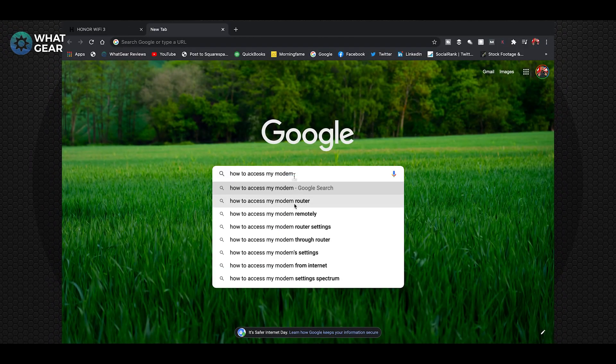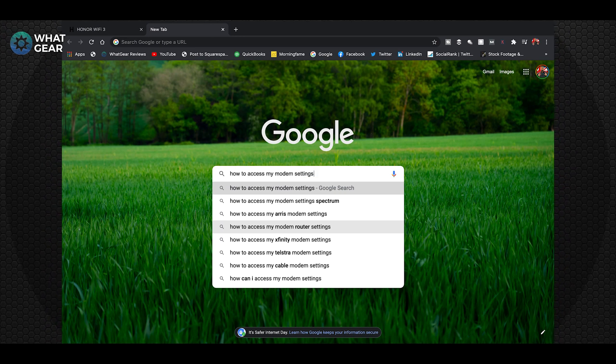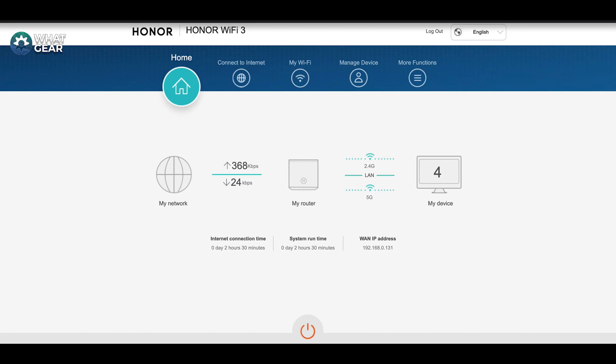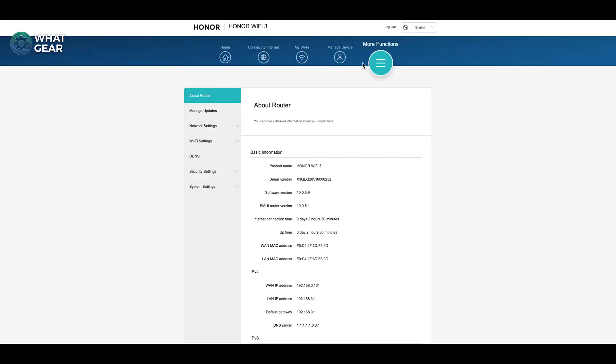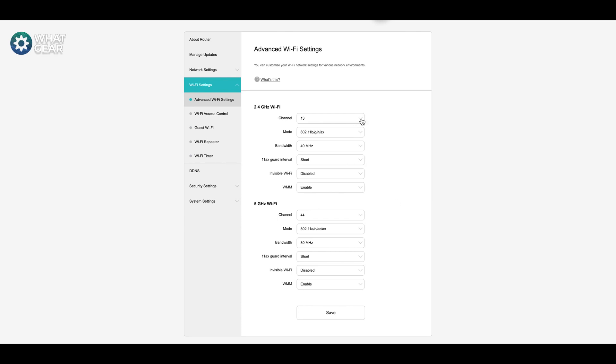This next bit gets a little bit techie, but you've come this far so don't give up now. What we need to do is log into your modem's settings page. Some of you might know how to do this already. For those who don't, the easiest way is to simply Google 'how to access my modem settings' — make sure you enter the type of modem or ISP you're using. Normally the address is something like what you see on screen. Once you hit enter, you'll need a password — your ISP will normally have a generic one unless you've changed it. Once you're in the modem settings, navigate to your Wi-Fi settings. Click through the menus until you find a page where you can see the 2.4 gigahertz band and the 5 gigahertz band, and underneath you should be able to select the channels manually. Remember those channel numbers you wrote down on that piece of paper that were free? Manually update them here, then hit save. Hopefully we've now eliminated any Wi-Fi interference — run your speed test and let me know in the comments how much of an improvement you're seeing.